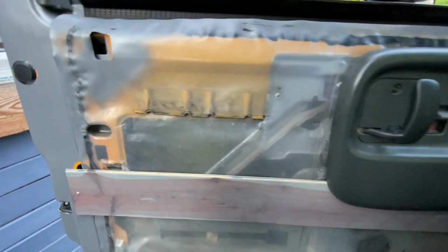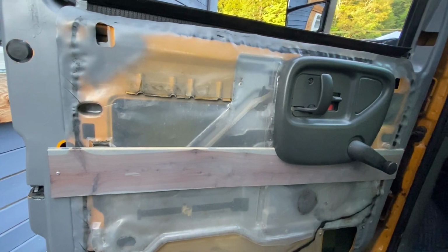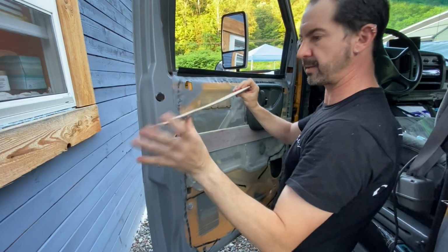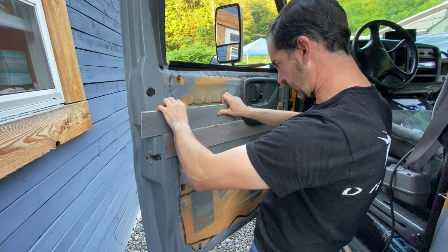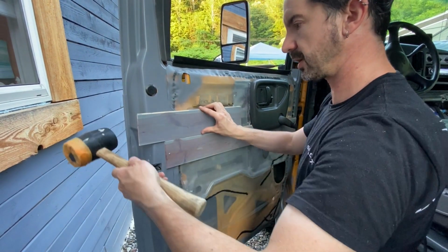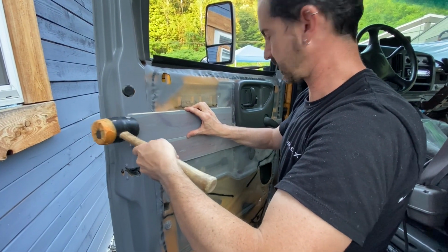We are installing paneling. So we're just riveting on the edges. We stained cedar with a nice translucent slate gray, which is going to match our rustic shuttlecraft space probe aesthetic. Some of these have a little bit of a warp to them, so you kind of have to bend a little bit as you get the tongue into the groove, but once it's there, it'll kind of hold for you, and then a nice little soft mallet. That rubber mallet's perfect.